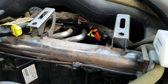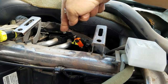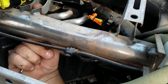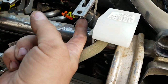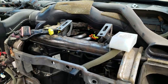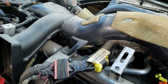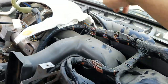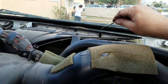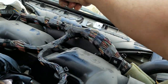What the other videos don't show you is that these two mounts are where the airbag is bolted. The box is in here and that round subwoofer-magnet-looking thing is right here. After you get everything else apart, you have to use a four-inch extension on a ratchet coming up from below — you can barely see these two bolts. Also, after you pop the defrost grill, not only do you have the big obvious bolts — I think they were 10mm — but you also have some seven-millimeter bolts holding things on. I had taken the airbag off and those big bolts out and still wasn't getting anywhere until I found those seven-millimeter bolts up in there.